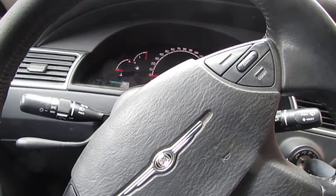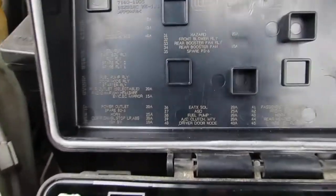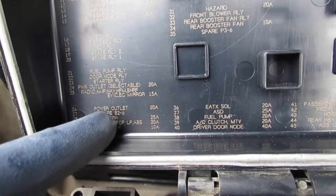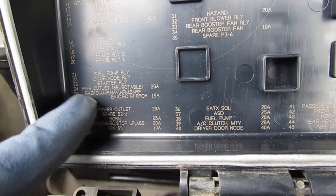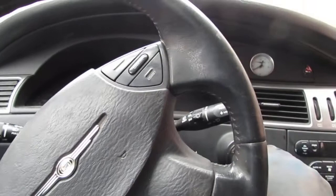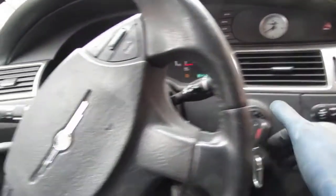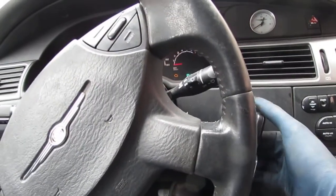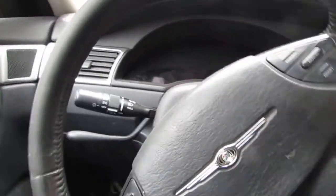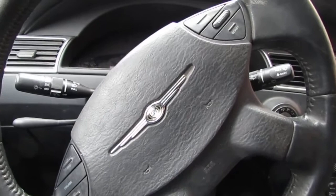Let's put that back. Now as a relay, we're going to double check — right here is our starter relay number 23. Alright, that relay's out. Perfect — see that, there's nothing. So we know that all that clicking sound is coming from the starter itself.